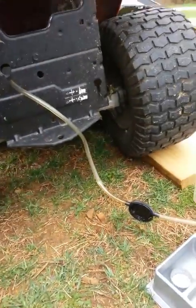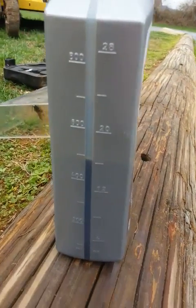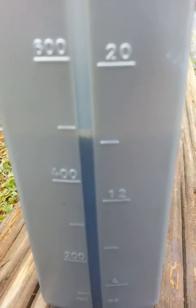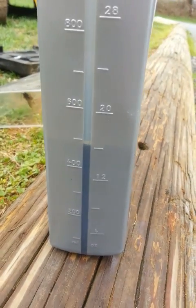I've pretty much gotten out what I could — about a five-minute process at best. As you can see, I've gotten out about a half a quart of oil. The capacity of that transaxle is a little over a quart, so I'm only able to change out about half.